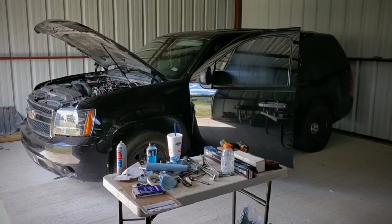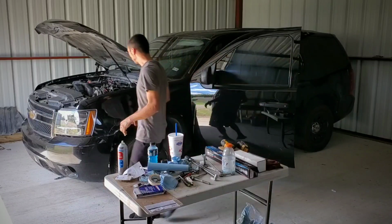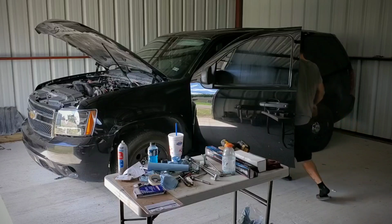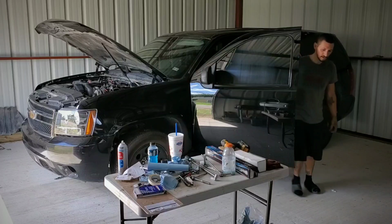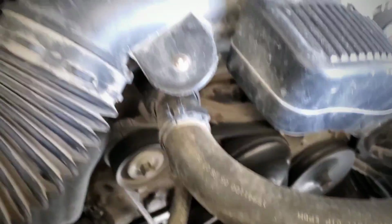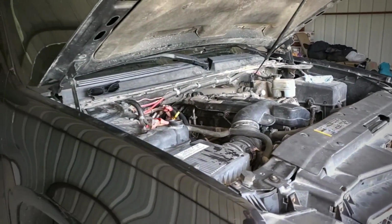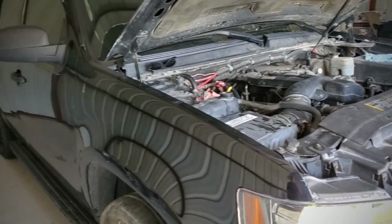All right, test one. I don't know if that was... We'll just make oil. Let's crank one more time. Something sounds weird. Let it settle in. The oil pump was completely dry because I took it off completely. The lifters are new and they need to recharge in oil, but let it warm up, let everything circulate, and right now I'll give you guys an idle.